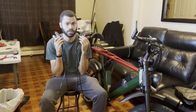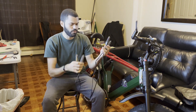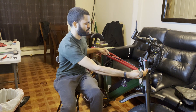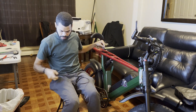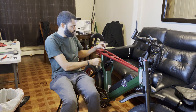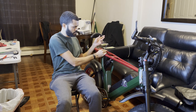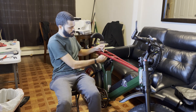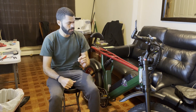Now that all your wires are spliced together, mount them back onto the bike and route the wires roughly where you would put them all the way until they reach the main wire. Pull out some of the extra wiring that is inside the tube so you have about that much exposed — that way when everything is done you can tuck the spliced wire back into the tube so it's protected from the elements. Now go ahead and cut this wire.